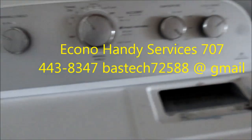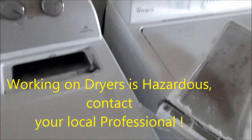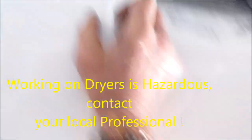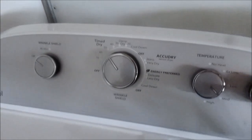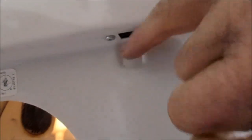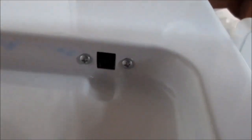Here's your Whirlpool dryer. You've checked your lint, there's no lint vent blockage, it's not kinked, and it won't turn on — nothing happens when you push the button. If you open your door and look at your door switch, you may find it's not there — it's busted, completely off. Normally there's a little tang, a small sensor arm that sticks out. When you shut the door it activates the timer. If you don't hear that click when you shut the door, that little tang on the switch is broken off.